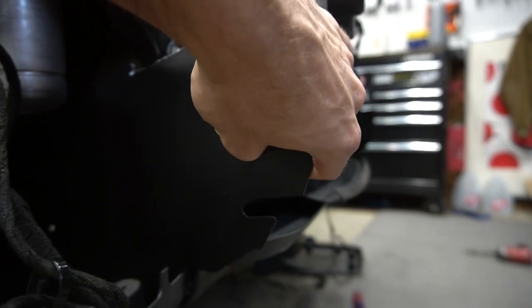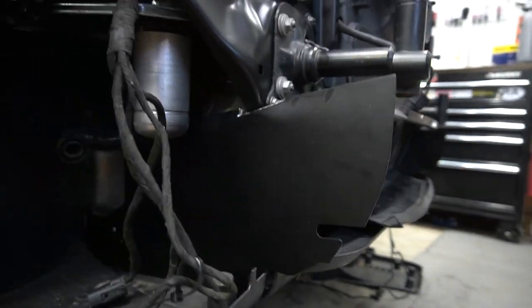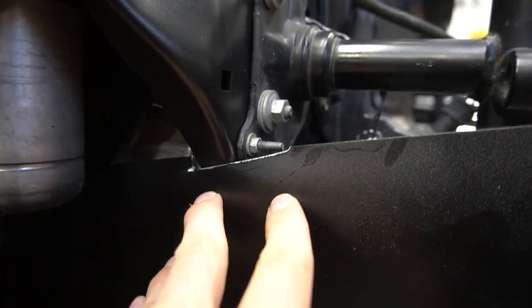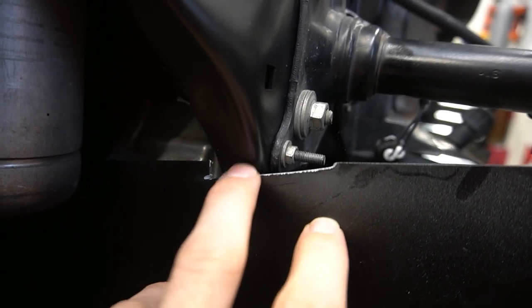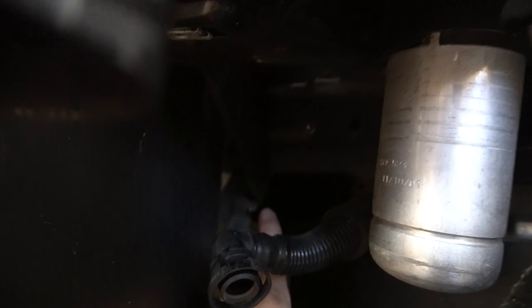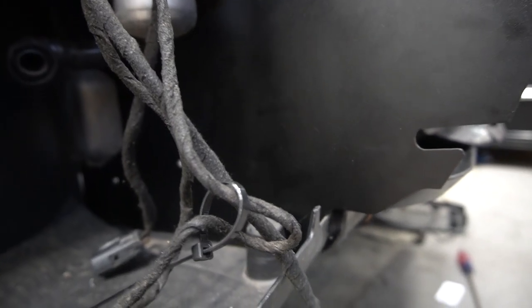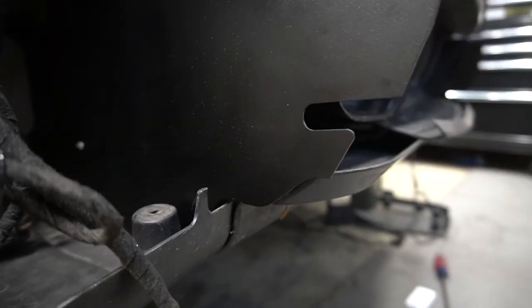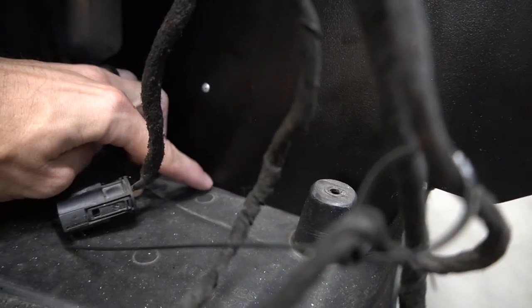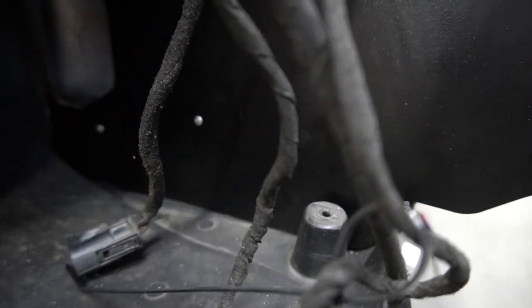And then obviously the front of this is going to go in at the bumper, I'm guessing. I hope it's sticking out kind of far, but apparently that's the way it goes. So this doesn't look too pretty, but I wanted this to fit as tight as possible, and this was in the way, so I just notched this out. And I also notched out this back corner piece to have it fit a little bit higher. But make sure before you do any cutting to mock up your pork chops in this, because I have it to where the pork chop wedges under nicely. There's maybe an eighth of a gap, and once you wedge the pork chop in, it's a nice tight fit.